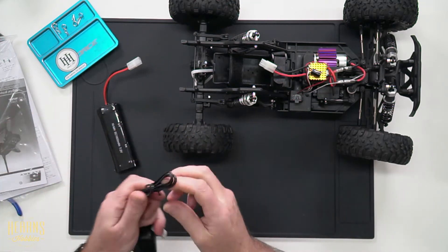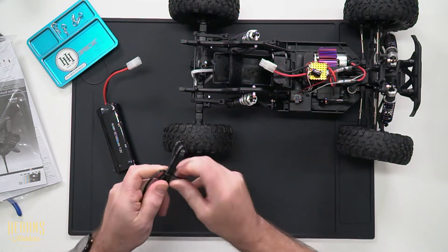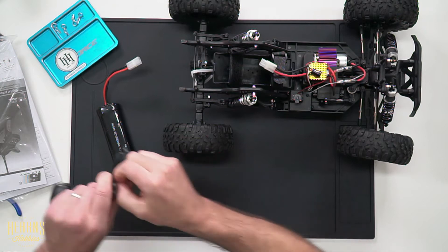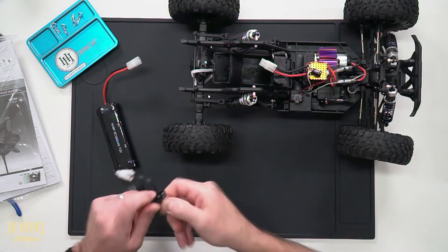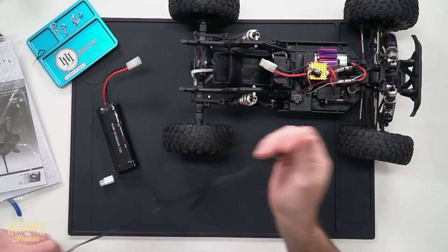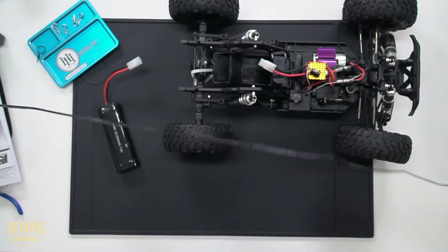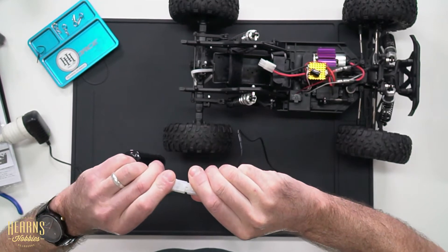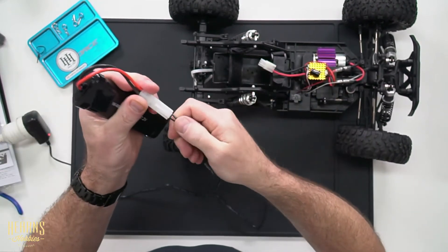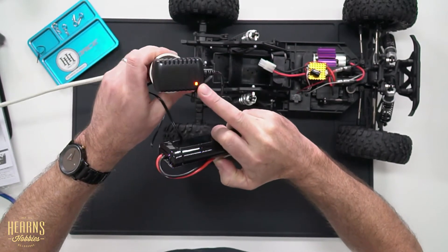This is a very simple but rugged and reliable 240 volt charger, which is really handy. It's not necessarily very high amp — 2 amp would be the rated output. This battery should charge in an hour or two. It's very easy to use, very reliable, and it's exactly what you want for your Octane. It's really safe and easy for kids to use as well. So we're going to plug this in and get the battery on charge. Here we have our 240 volt wall plug and the supplied charger. I'll go ahead and plug that in. We've got ourselves a green LED — means it's on, and it also turns green when it's finished charging. We'll plug the battery in — simple white connector that's really hard to plug in backwards, fairly robust and reliable. You can see our charge light's gone to orange — that means it's charging.